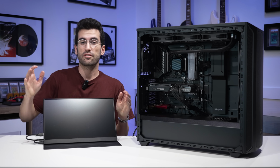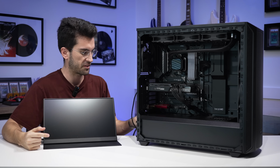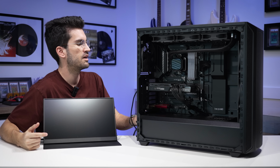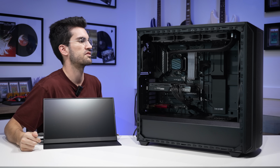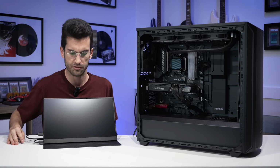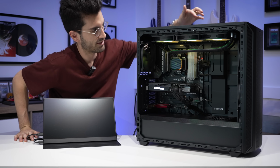Last things to do then, we of course need to make sure that it turns on, that it posts, and then like I said earlier, I'm gonna hop into the BIOS and tweak his fan curves a bit. We'll also re-enable DOCP and try to get things back to where they started. We removed the CMOS battery earlier in the cleaning process, and so that very likely reset his CMOS. In fact, I'm pretty confident. If it didn't, there's some kind of weird juju going on with this board. So let's power it on up front.